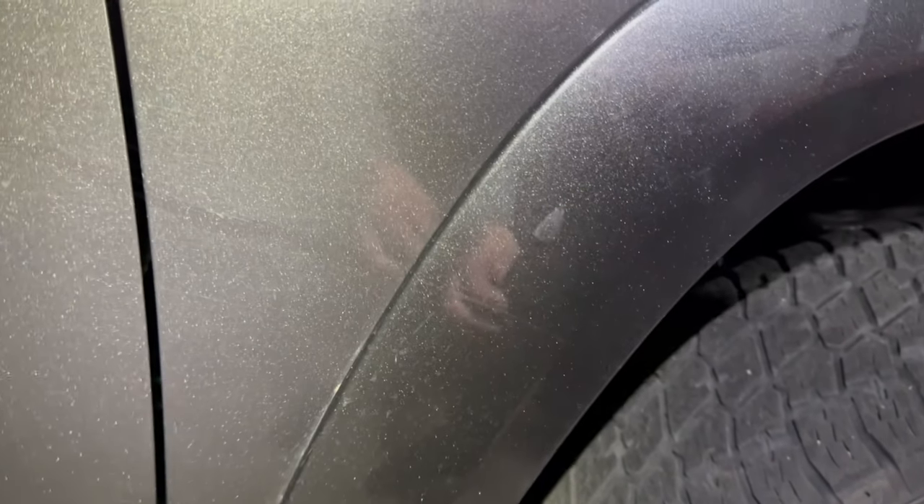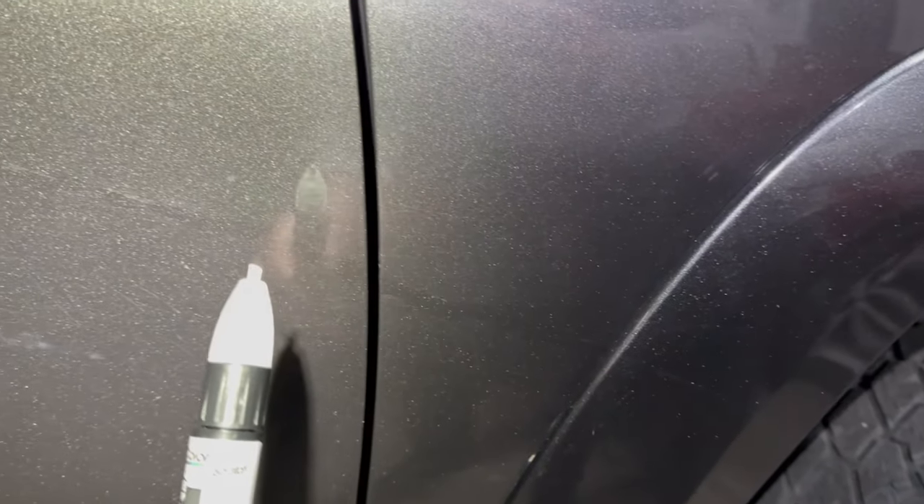Along the side of the front there's a pin stripe that extended all the way down. You can see where I put the clear coat — it almost just disappears and blends right in. Right there is where I did not put clear coat, so you can compare the two. The pin stripe was pretty superficial — it wasn't through the paint, just through the outer surface layer — and by putting the clear coat on it almost just erases it. It's just almost gone, which is really nice.